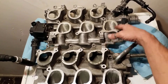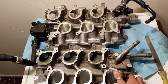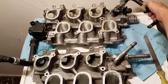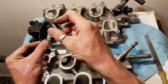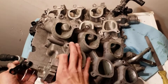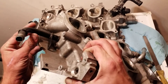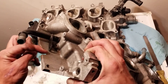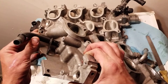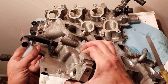I actually pulled this directly off my vehicle to show you guys this video. We're going to look at the two stages — so this is like when you get it from a junkyard and there's nothing on it. You still got to put the Mustang hose on. When it comes out the back, the first thing you've got to do is that this hole doesn't match up. When you put it in the outlet, you actually got to drill that hole right there. So you push this down, hit it with the drill, and basically sink it with an M8 by 1.25 standard bolt. That's the easiest part — you can just sink that.